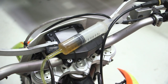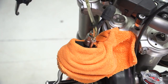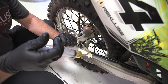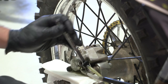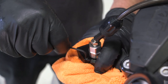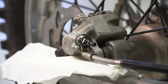Now it's time to top off the fluid and seal the system. Once all the air is bled from the system, place rags around the bleed port of the Rekluse master cylinder to avoid fluid spillage. Unscrew the bleed fitting from the master cylinder. Using the syringe at the caliper, gently force a small amount of fluid to the top of the master cylinder bleed port and reinstall the bleed port screw. With the bleed nipple tightly closed at the caliper, fluid should be flush at the bleed port when installing the screw. Then remove the end wrench, syringe hose, and replace the dust cap on the bleed nipple.